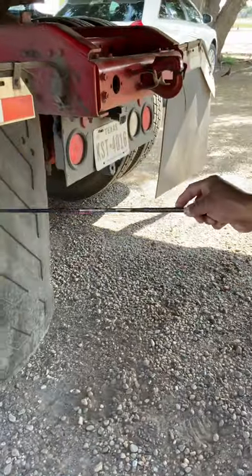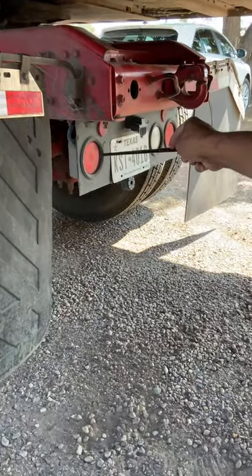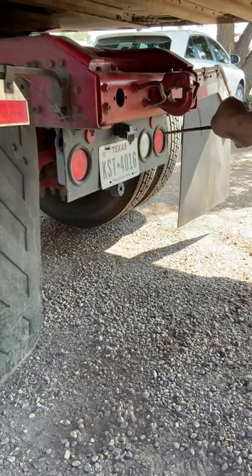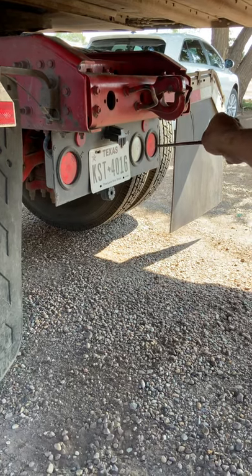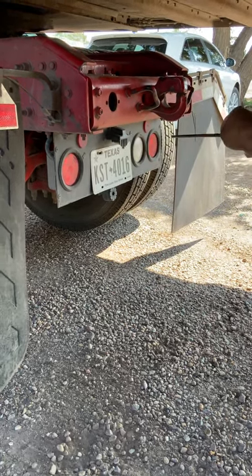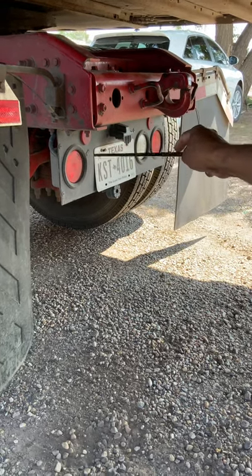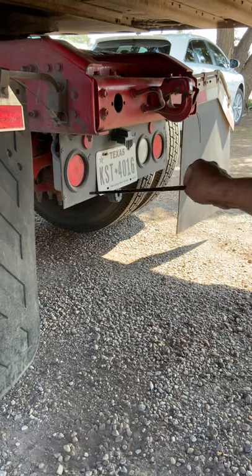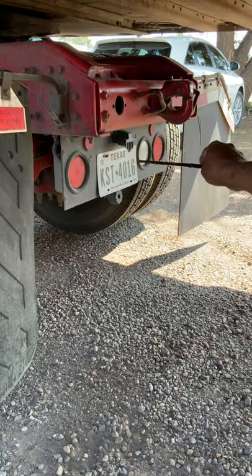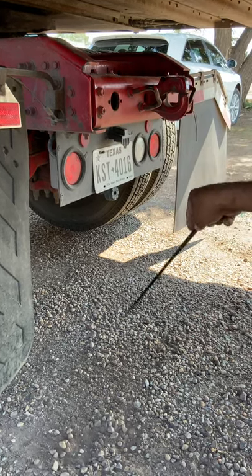Then I'm going to check the lights. My red lights include turn signals, four-way flashers, brake lights, and running lights. The reverse lights are clear color and the license plate light is clear. Make sure all lights are properly mounted and secure, not cracked, not broken, clean, no missing lenses, and the proper color. My license plate is properly mounted and secure: no cracks, no breaks, no missing bolts or nuts — clean, visible, and up-to-date.